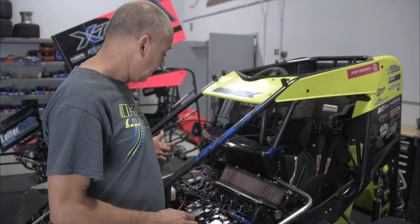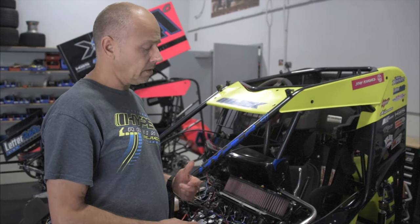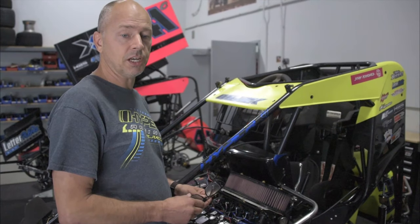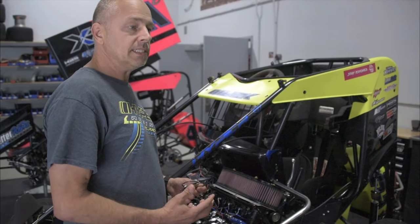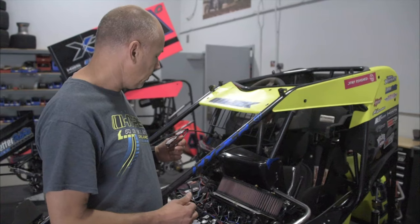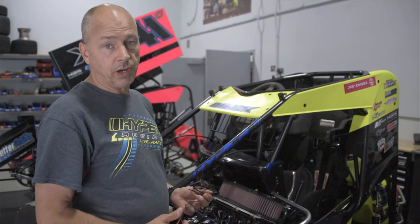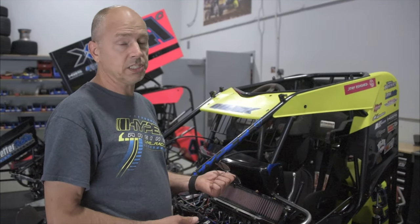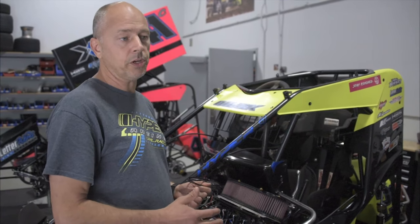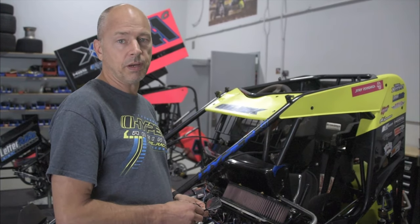That's it. The $499 plus the O2 sensor, which I think is $380, that'll give you all the data that I need to tune your ECU for you. Or if you have a Mychron or a power commander, you could make some adjustments yourself in there. The TPS signal, throttle position sensor, which the fancier systems will give you access to. This won't do that, at least not easily. It can do it. But on the data, I can tell when you're on or off the throttle. Micro sprint racers are either on or off, unless it's a real slick track, which I can look at the G-force to see if it's a slick track, and then I can see if you're lifting off, and I can gauge there where you are on the map when I reflash your box for you. So I don't really need the TPS sensor signal in order to be able to create a custom tune for you.